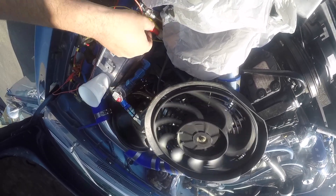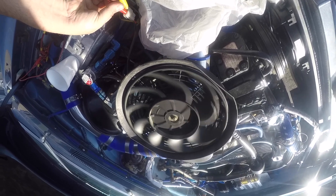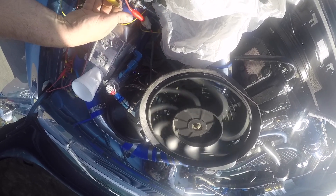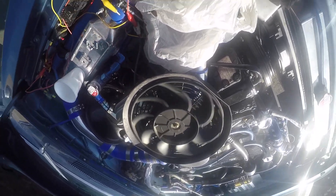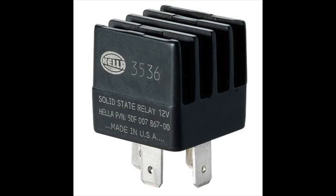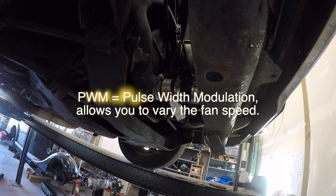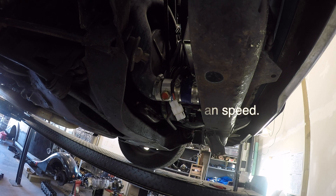When we added fuel injection, it gave control of the radiator fans to the ECU. Switching to Hella solid-state relays gave me the option in the Haltech software to pulse-width modulate the fans or choose when to kick them on. It was much easier to change my mind on how to run them, and that worked pretty well with just a naturally aspirated fuel-injected car.